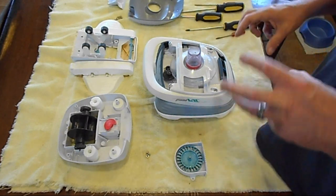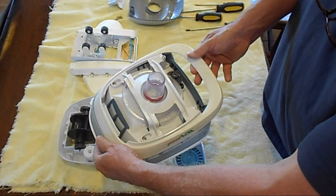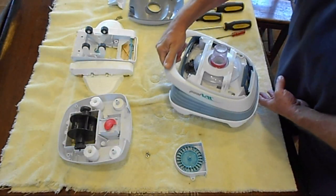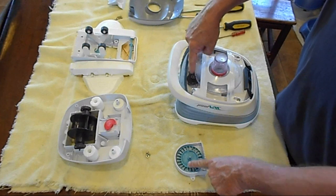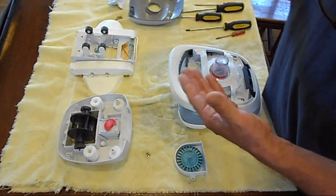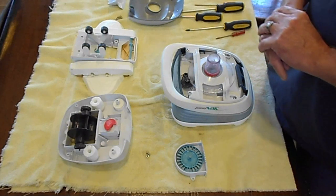If everything is connected and still functioning correctly — not grinding, chipping, or banging — you're good to go. But these are the main culprits causing your vacuum to go into a corner and just sit there. You pull the hose back, it may go left or right a little, then boom — right back in the corner. Diagnose the gearbox first, then go after the internals. Typically it's the two gears and that bushing that need replacing. If you cleaned out hair or debris and it still does the same thing, you're probably going after those three pieces. Thanks for watching.